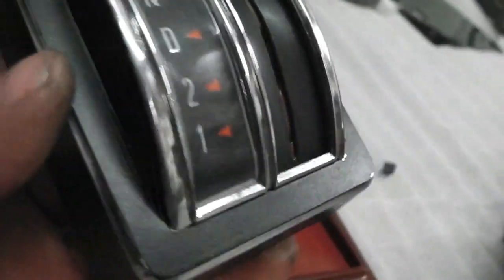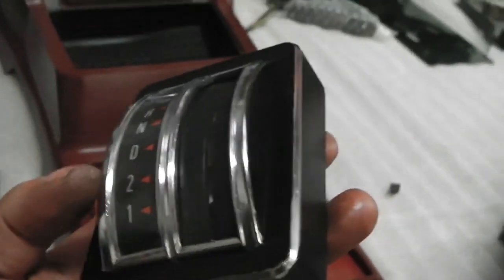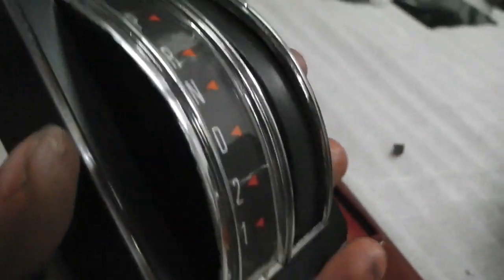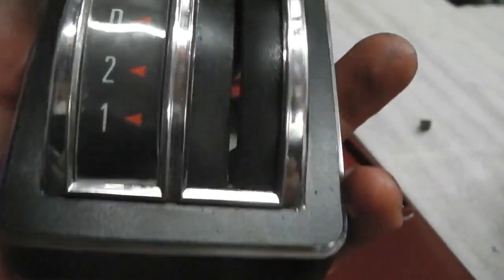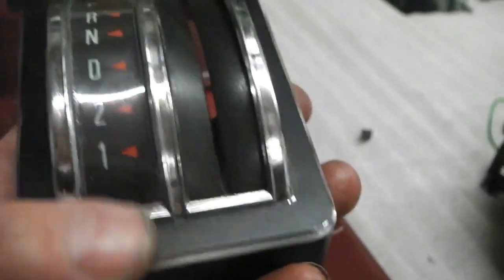Anyway, cleaned this up. De-dusted it because it's all dust ingrained in it. Then it was stripped back to its aluminium, to its chrome finish, and you could be tempted to keep it chrome, but they actually keyed the chrome and scored it, or scuffed the chrome. So even if you do want to de-chrome these, certainly the later ones, because there's two types of these as well, we noticed the later ones are scuffed on the chrome, so when you finish it back you end up with a not good chrome finish anyway. So this was remasked and then re-satined to give nice detailing.